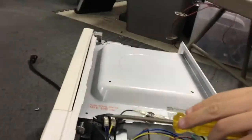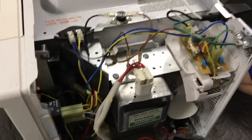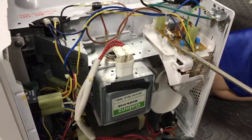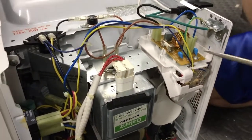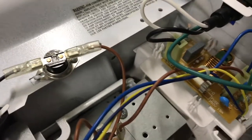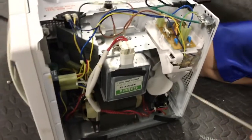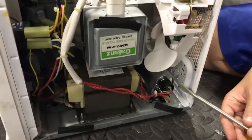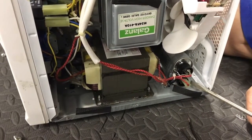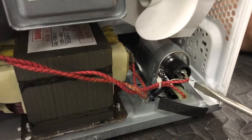There are two ring magnets down here — probably hard to see on camera. Then you have the light bulb right here. These are things you can touch, though be sort of careful with this one. These guys over here can still be charged, so watch out for those — they can really hurt. This is the 'don't bring your fingers even close to it' — that is the microwave oven high-voltage capacitor.